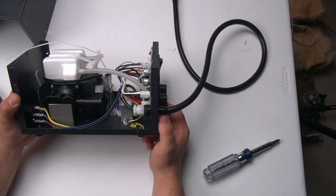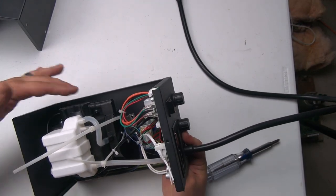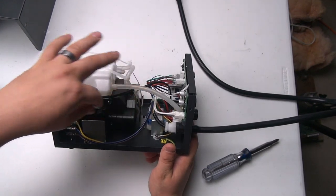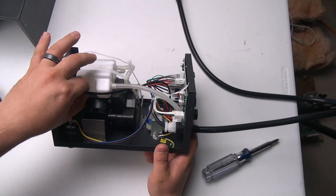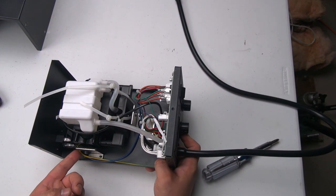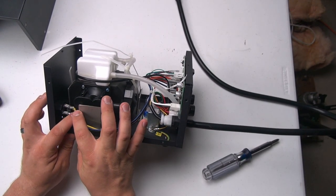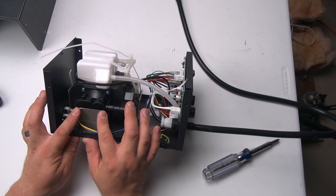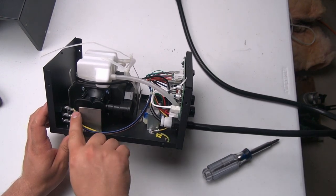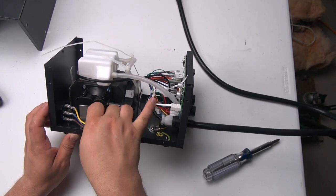Looking at the mains wiring here - they don't have a bump stop on this side but they have a bump stop over here, so they have three bump stops all the way around. The mains wiring looks okay I guess. I don't like the fact that the wiring kind of rests up against this bump stop - it's not sharp on the corners per se, like it's not going to cut my finger open, but it could over time put a gouge in the wiring.